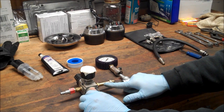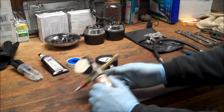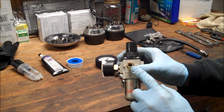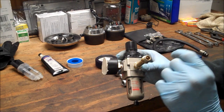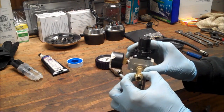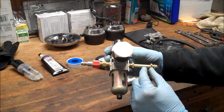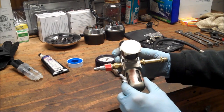Basically, I mixed up some epoxy and pushed it in this pipe, let it set up, and I drilled a 40 thou hole in there. I believe it's a number 60 drill bit. That's a 40 thousandths hole inside the epoxy plug that's in here. The epoxy is packed in about half inch, quarter inch — just enough to plug it and then just drill the hole through.